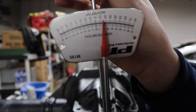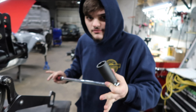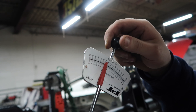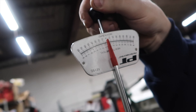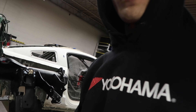We're just below 20 - our maximum is 28. With a new bearing you want to be on the tighter side, so we're going to give it another hair of a turn and hopefully we don't go over it, because now it's really really easy to pass it. There we are - 21 inch-pounds. Our high end of the spec is 28, so we're going to leave it right there and not touch it, because if we mess it up we have to take it all back apart and start again.